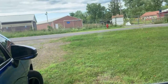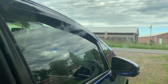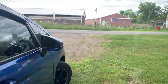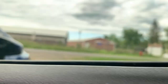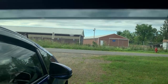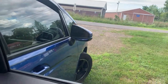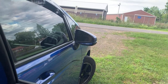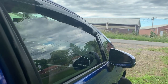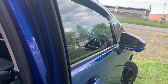Same window — right side I did with the steamer, left side I did without. Right here is where I was pulling fast — you can see the glue there. And over here, there's pretty much no glue at all. From my experience so far, the steamer makes it pull a little quicker, but you're juggling stuff around. As long as you take your time, most of the glue will stay on the film. So if you have a steamer, go ahead and use it. If you don't, just be patient.